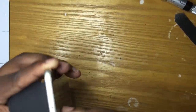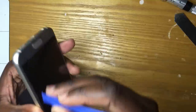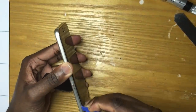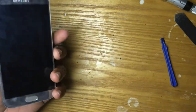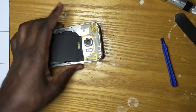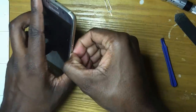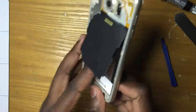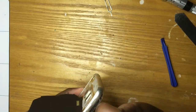We will try to separate a little bit of the glue around the LCD and try to completely separate the LCD assembly from the middle frame of the phone. We remove the SIM tray from the phone. You want to do that well before you start — you want to remove the SIM tray before you try to pull out the LCD from the frame.